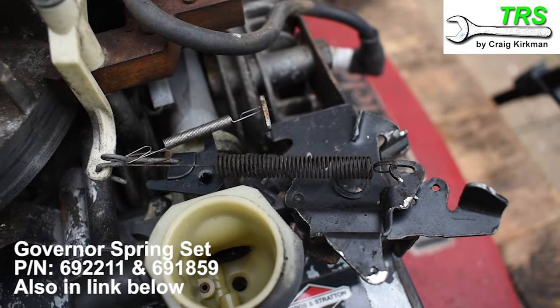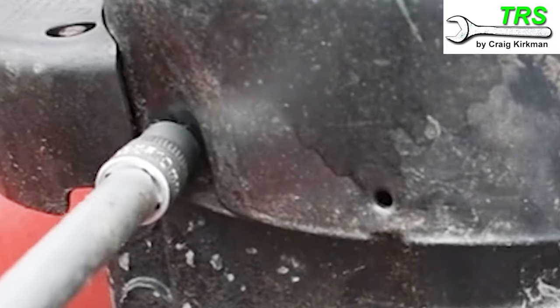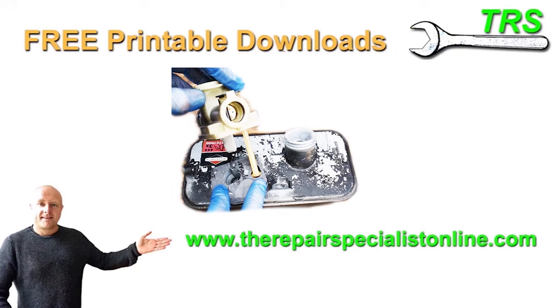Just to make sure, when I move the governor arm the throttle linkage moves the throttle lever. Then I shall place the recoil back on and fix in the securing bolts. All that's needed then is to clean and refit the air filter. If you would rather have a free printable download leaflet there's a link in the description — it goes directly to my website where you can download an easy-to-follow step-by-step instruction on how to replace these diaphragms, and the best part is you can print it off and take it into the workshop rather than bringing your computer or tablet. Thank you so much for watching this video — please give me a like and subscribe if you haven't done already.